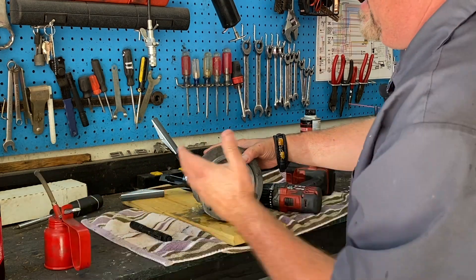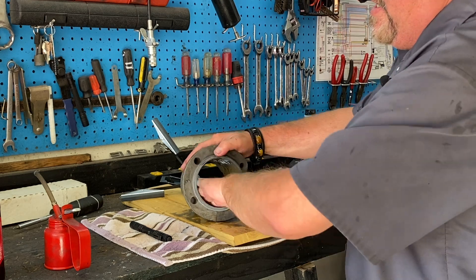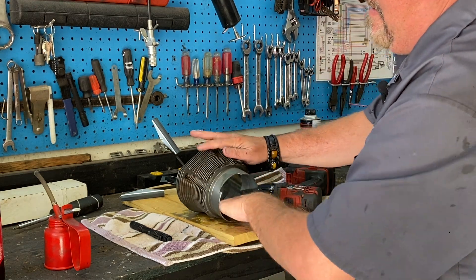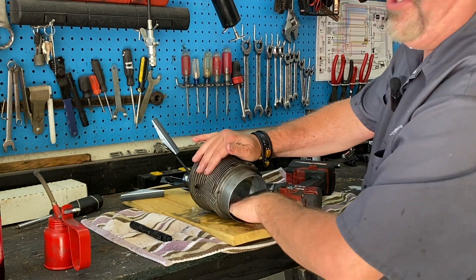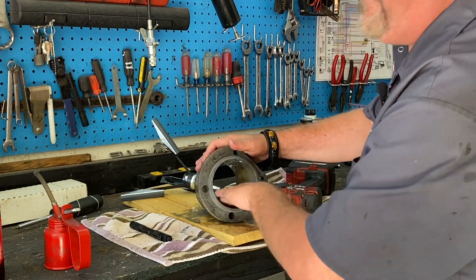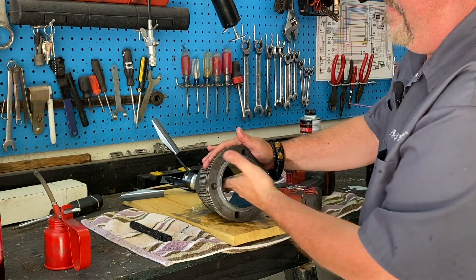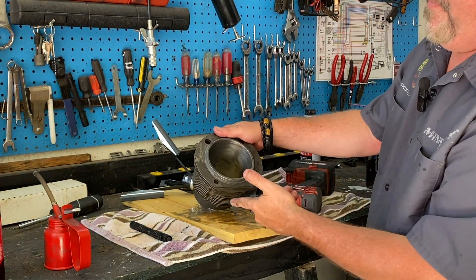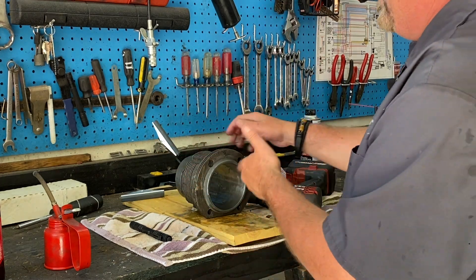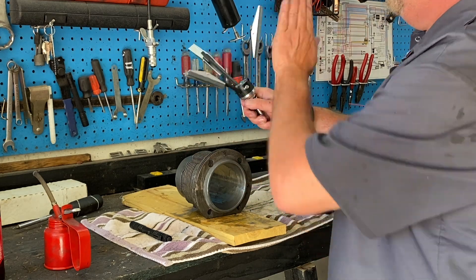Take your hand, get it in there, and coat the entire inside of that cylinder. You can do this on both a German air-cooled motor and an American V8, V6, or four-cylinder — it's the same process. Same for Porsche and Volkswagens. They have a little spot where you can lay the cylinder, which kind of helps out.